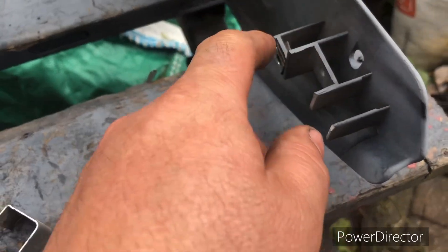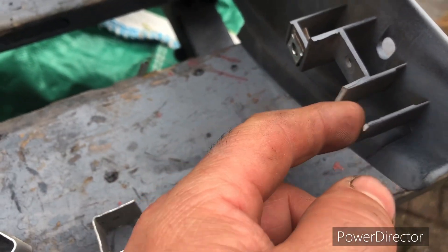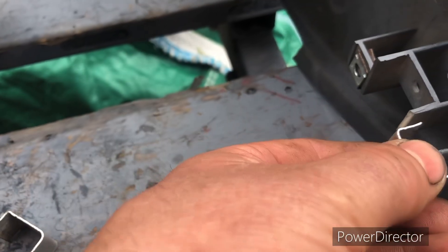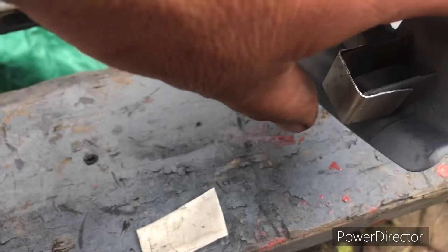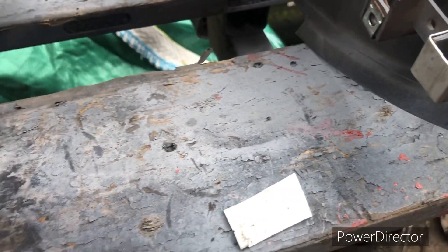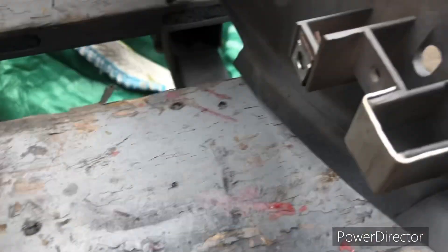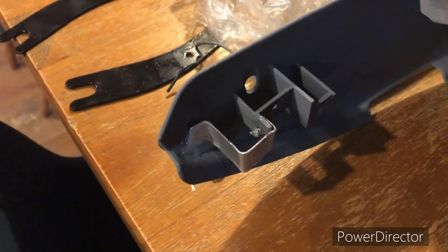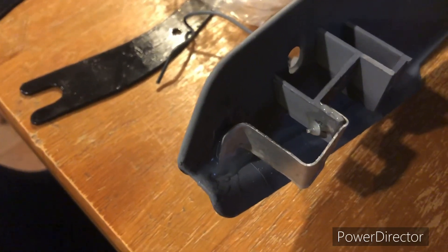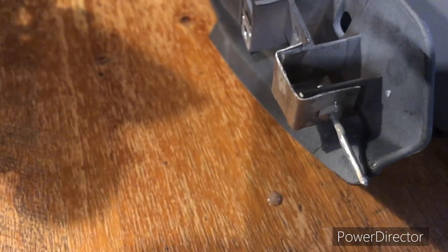There's a little job to get on with. These panels are broken - not all broken, but there's a piece missing here, and on the other one it's completely missing. I've got some little bits of 1mm aluminium to fill those gaps, and I planned to use pop rivets and JB Weld. That didn't quite go to plan though - it's far too fragile, the plastic is very soft, and the rivets are imperial while I only have metric drills. So all I've done is left the rivets in and put lots of araldite everywhere. Hopefully that'll be alright after sorting out tomorrow.